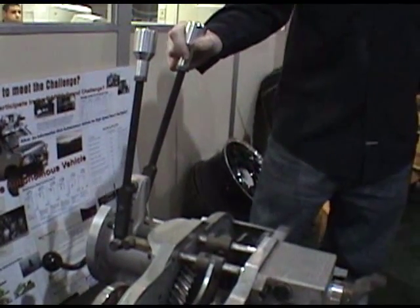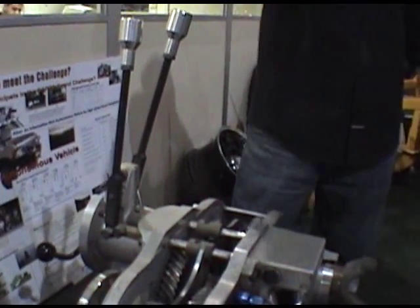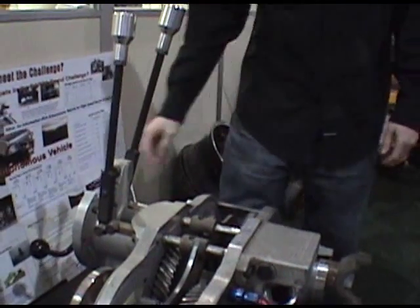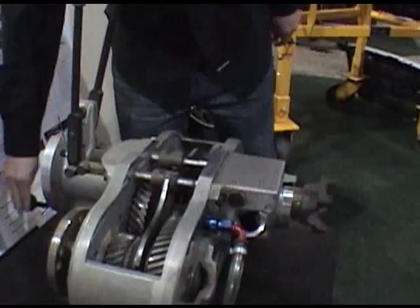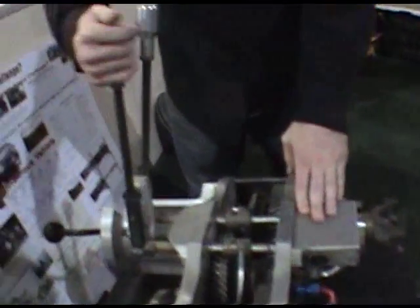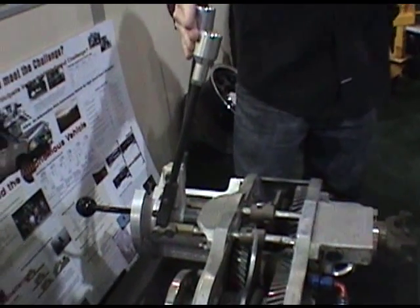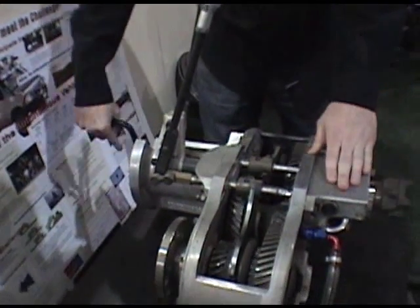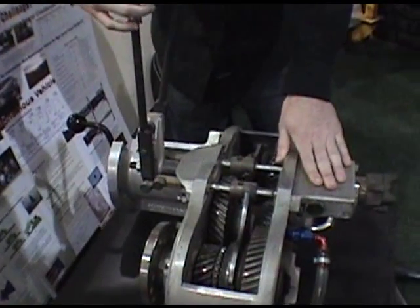In high for everyday driving — that makes sense, right? We're getting power to our rear wheels; it's a rear wheel drive vehicle. We leave the front in neutral, so no power to the front wheels. This goes to the rear axle, and this goes to the front axle. If we want four wheel drive, we simply drop the front down into high as well — that's four wheel high. Now you see we're getting action to both the front and rear axles.